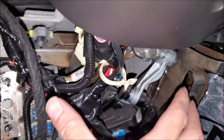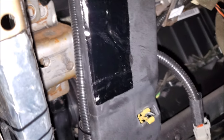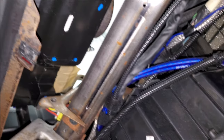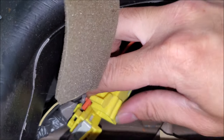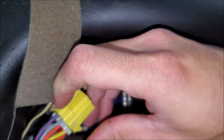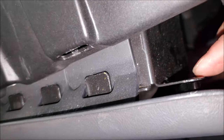We've gone ahead and removed the metal shroud here. I've also loosened the column to get a little bit more play out of it, and then there are two 13-millimeter bolts in here as well — you can see they go there and down below there. Because you've disconnected the battery, there are two 10-millimeter bolts here for the passenger side airbag. You can come up here and unplug it: pull out the lock, then depress this clip and it'll separate. There are two more 10-millimeter bolts holding in the airbag — you can grab a long extension and come through this way on both sides.